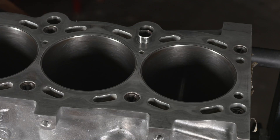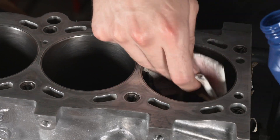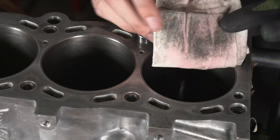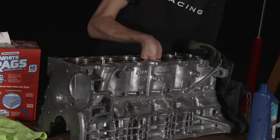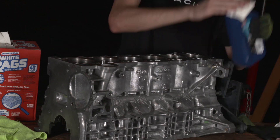The reason I'm starting at the bottom and working my way up is because my hand is touching all over the cylinder, and I don't want to stop while I've got my hand oils all over it. On the first pass, you're going to see the paper towels just covered in gray — that's good, because you're getting all of that crap out of the cylinder wall, out of the hone hatch. You don't want that in there when your rings are trying to seat. Repeat that process with a clean part of the paper towel until you get a completely clean, red section of the paper towel.